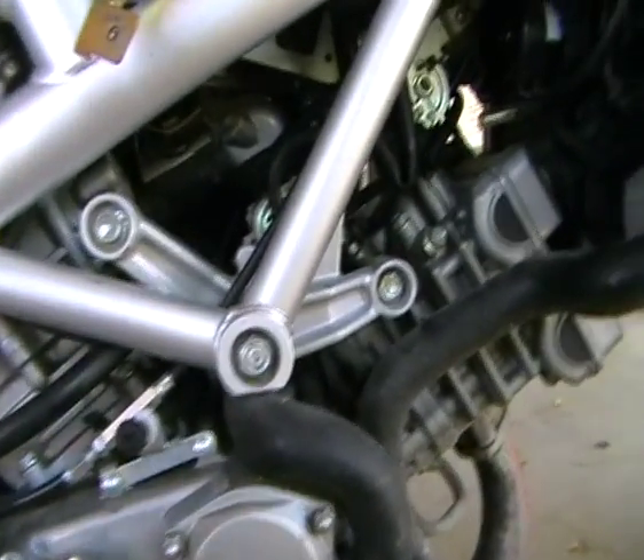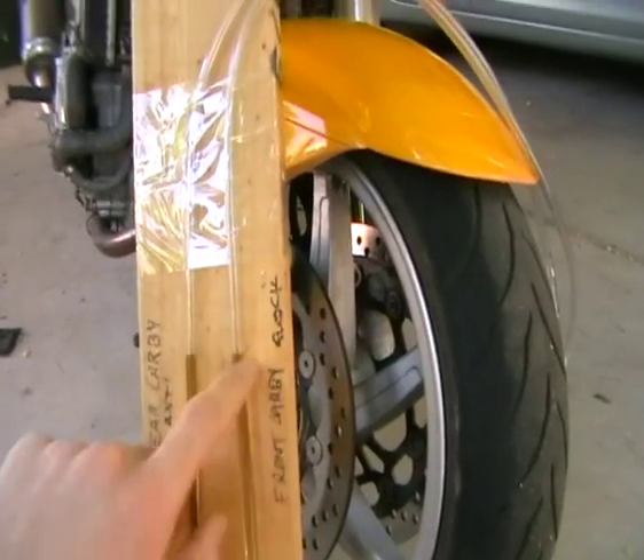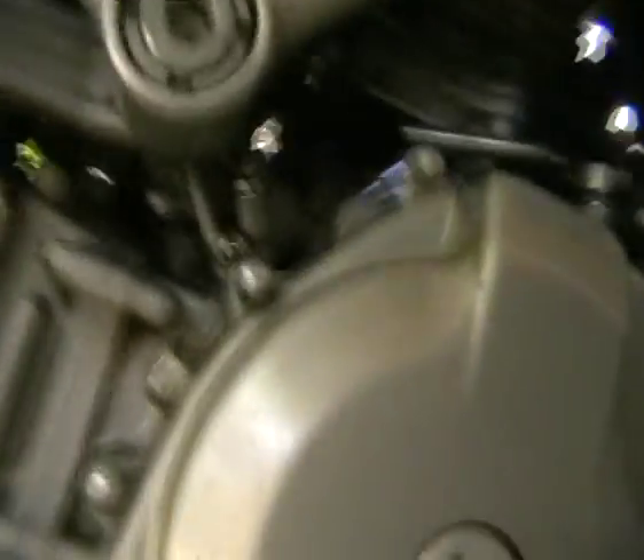When you're tuning it, start it up and see which side of the manometer shoots up. If it goes toward the rear carb side, you need to turn the butterfly screw anti-clockwise. For the front carb, turn it clockwise. The adjustment screw is under here — it's kind of hard to get to. You come in from up under the tank and put your screwdriver through to reach the screw.